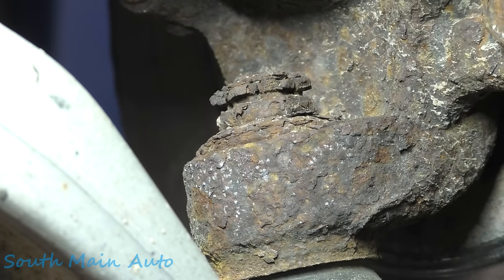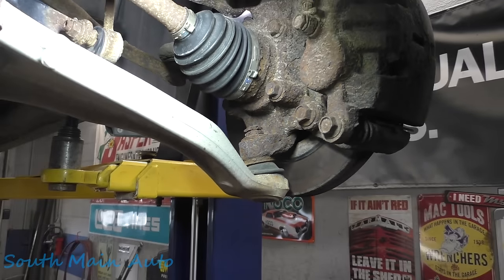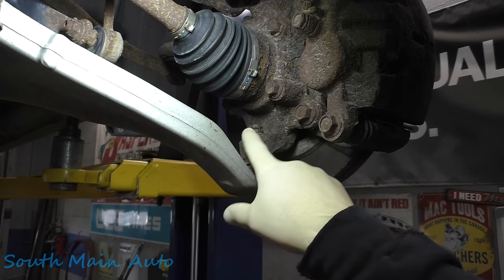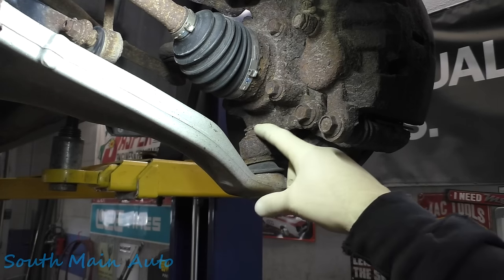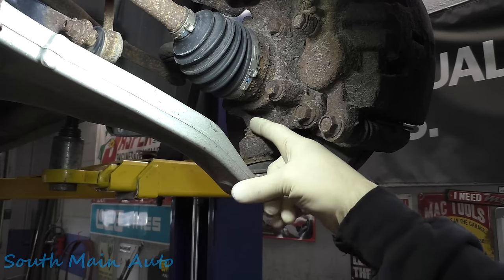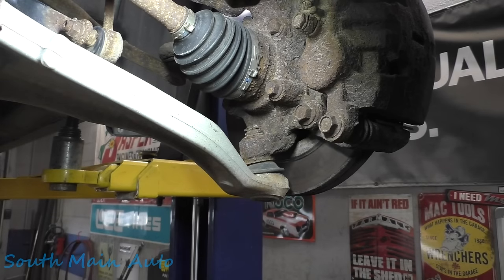There's our nut for the lower ball joint. As you can see, it's kind of non-existent — it's pretty crusty. We already did the other side. On that side we tried sticking the wrench on it but it was just crumbling. These are a great big flange nut. Instead of fiddling with it with wrenches, we're going to take the torch and split the front half off it, then the back half, and just knock it out of there and save a bunch of time.